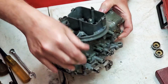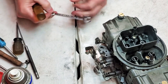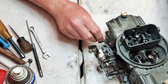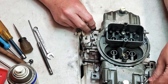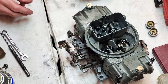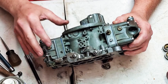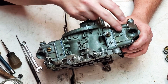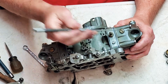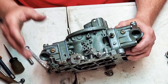Alright, we've got no clearance on our secondary, none on our primary - there's just a hair in that primary, let me take it out just a hair more. Your final adjustment on here for your accelerator will be after you set your idle. Once everything's done just right, go back and check these one more time front and rear - make sure you've got zero clearance, and at wide open throttle you have about fifteen to twenty thousandths. That's a good all-around spec. We set the mixture screws at one and a half turns, start the motor up, let the carburetor fill up, then come back and check the float level - you want it right to the very bottom edge of that screw.